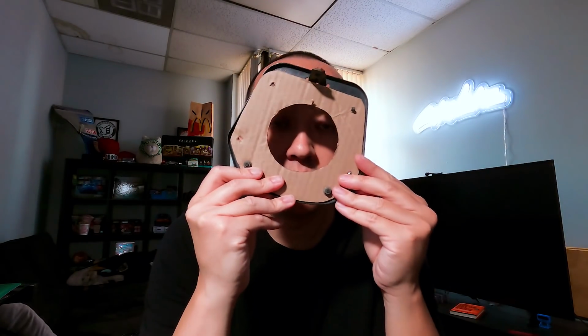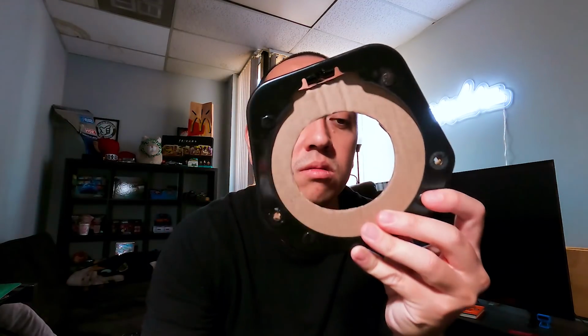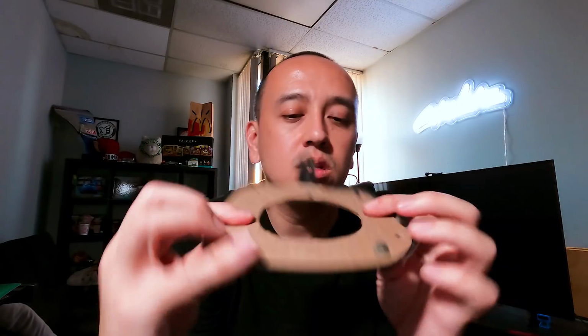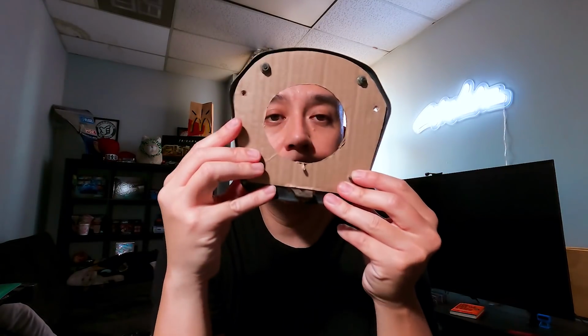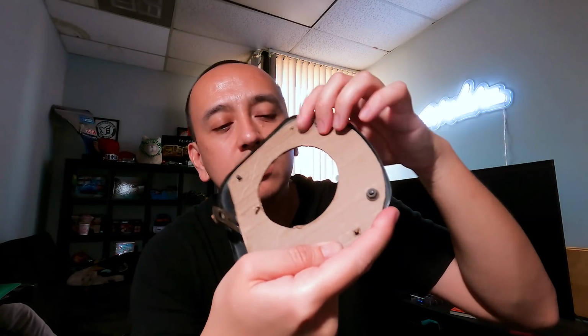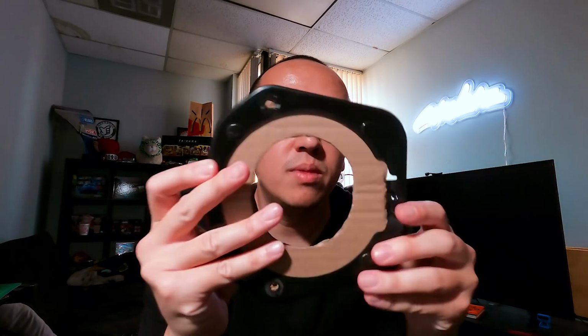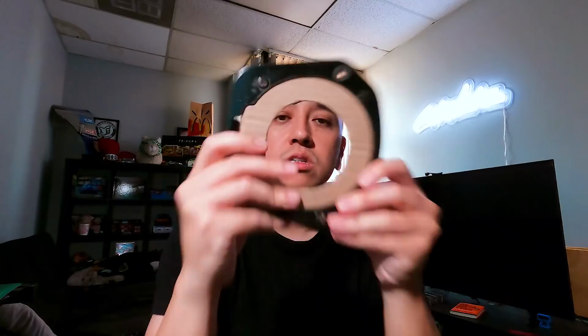That's the driver's side duct fit. Here is the bracket itself from the passenger side. And so I used an Amazon box and cut out a template of the diameter that fits the OD of the duct. Just Amazon box, shaped it to the back of the bracket, mounted it because there's holes. I mean, I made holes. I don't know what size bolts they are, but they mount up, and so I mocked it up. It goes into the car like this.